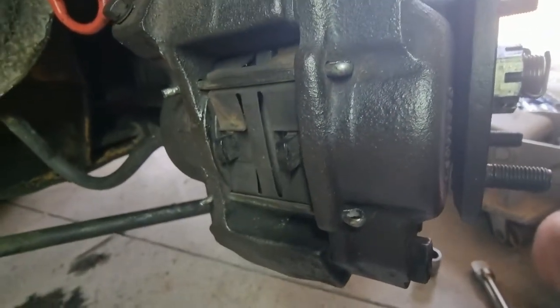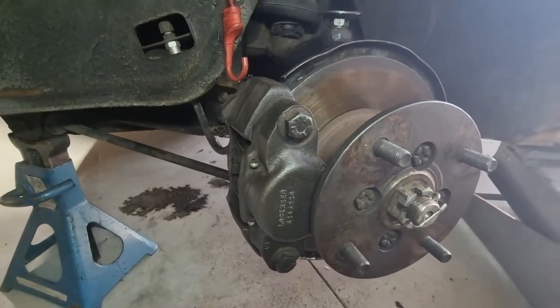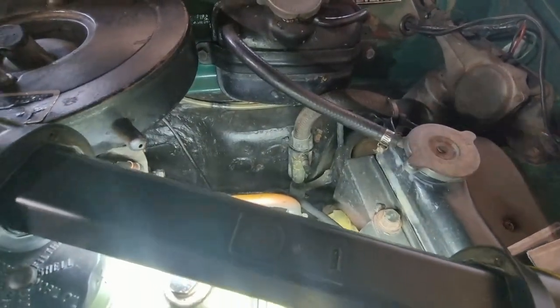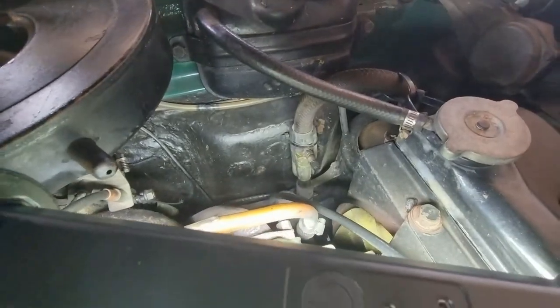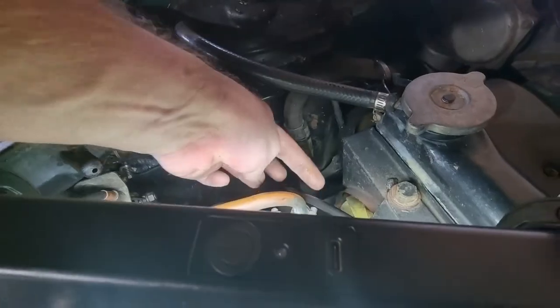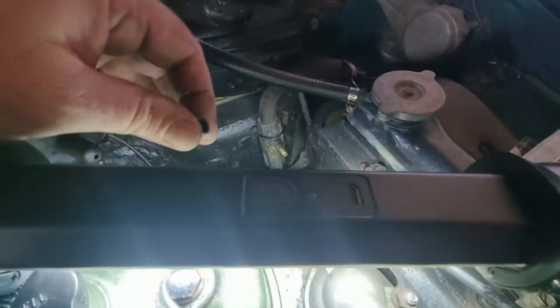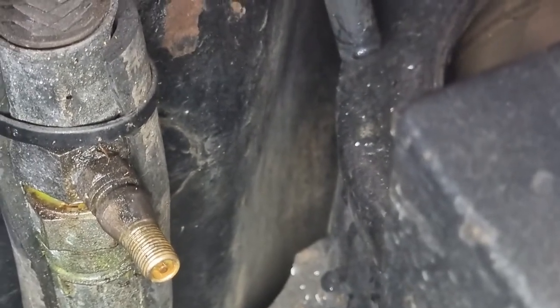What I'm going to do next, when I button all this up, is leave it on full droop and have a crack at getting the suspension level recharged with a new Schrader valve. This is a suspension issue — this part of the hydroelastic system here is a Schrader valve, which you need to provide a valve as you inject the hydroelastic fluid in there. Being a valve that doesn't let it come back out again makes a whole lot of sense. The problem with this one is it's leaking. I've just touched the valve cap and you can see some leakage — it's been a slow leak, so it's slowly lost suspension height. You can see some corrosion in the end of that, so it's got to come out.